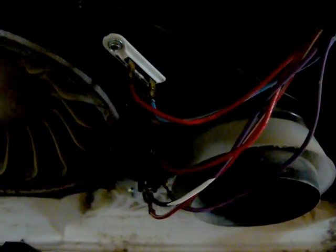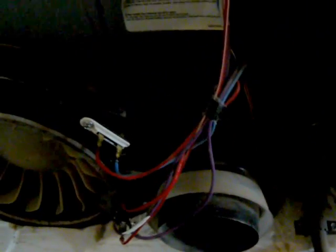If all these devices test for continuity, the fuse, the thermal cycling thermostat, these two upper thermostats up here, then your problem is going to be around the burner assembly, and you're going to have to take the front of the dryer apart and start with that. There again, test the continuity of the igniter assembly and all that. Look for any worn or damaged parts, because some of those parts are kind of delicate and they do go out. I just happened to luck out and get out of this one for 20 bucks.